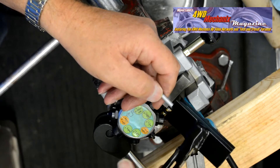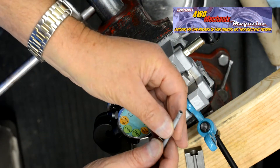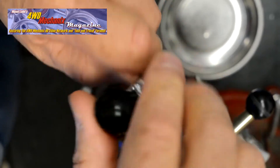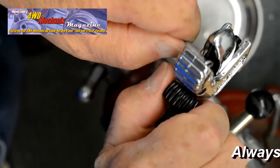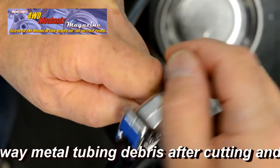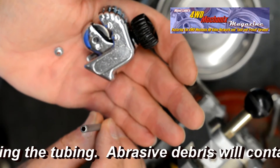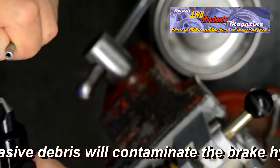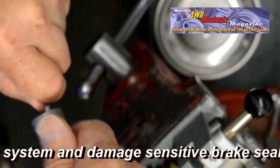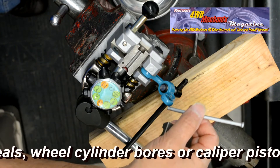This is the SUR&R tubing straightener and bending pliers. Tubing cut with a tubing cutter leaves a burred end that reduces the inside diameter of this 3/16 inch outside diameter tubing. A mini tubing cutter from OTC cuts just the flared end off tubing. This also leaves a burred end that has to be reamed. This tubing reamer from Inline Tube has 45 degree cutting angles for both the outside and inside diameter of the tubing.